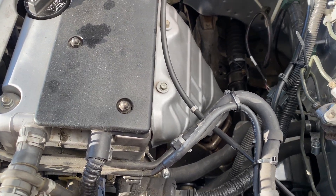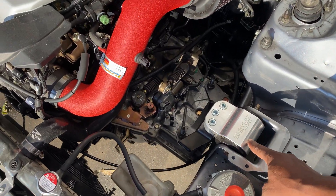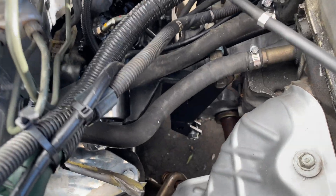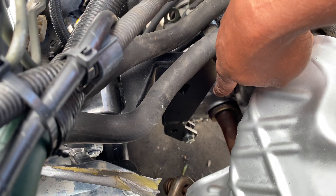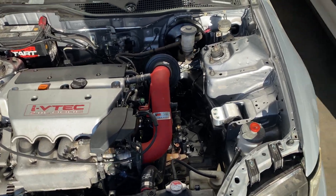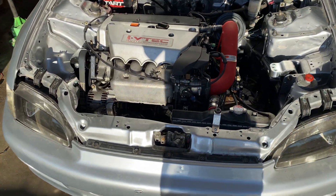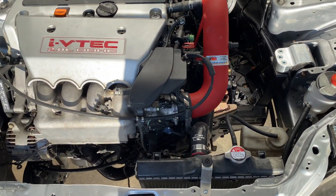This is running a stock exhaust manifold. Some people ask how to make it fit — one reason I used the Hasport mounts is because of the dual bolt setup. You can only use one bolt on some aftermarket mounts, but Hasport uses two, which gives the advantage of using the bottom bolt going to the top of the transmission for tilting the engine. I'll go into more detail in the next video on how to do it, including going from illegal to legal in case someone gets hit up by the state referee.